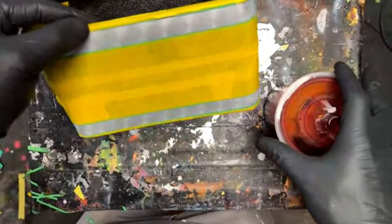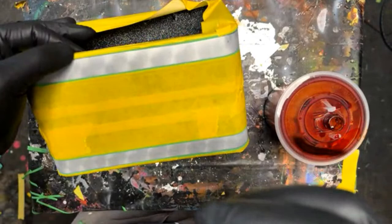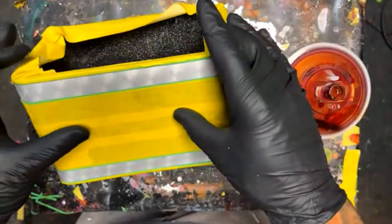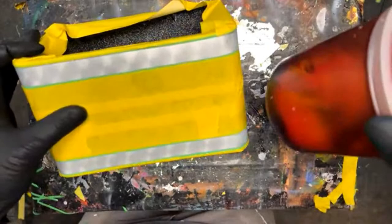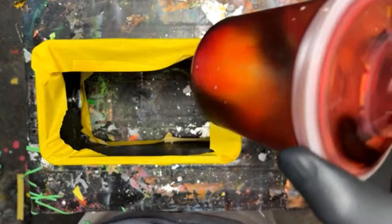So by laying this down on top of the spun silver leaf we have here, we're going to be able to dye the color into it and still be able to see what's below. This is a dye. It's not a pigment. If we were to do this with a pigmented paint, you're not going to get the same effect. So you want to make sure you're using a candy paint, also known as a tri-stage in the collision industry, I guess. You can see how vibrant and how transparent it is. Really cool stuff.